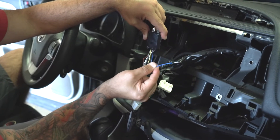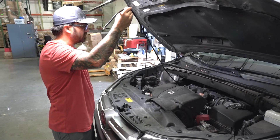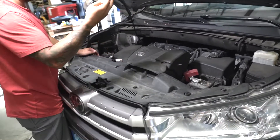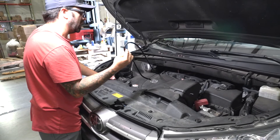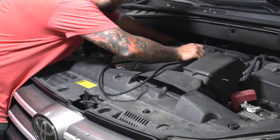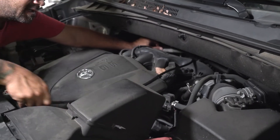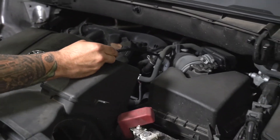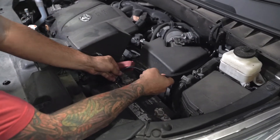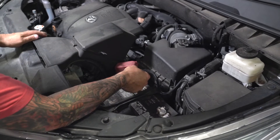We've got the 8-gauge amplifier wire kit included with our base package for the Highlander through the firewall. What's nice is we already have this premium braided wire covering on it, which makes it blend in with the engine bay. Basically we'll wrap this up here and zip tie it along the back, keeping it away from engine components that produce heat which could melt the wire. That's going to route all the way over to the battery. Your fuse holder will go in place where indicated, and this will be connected to the positive terminal of the battery.